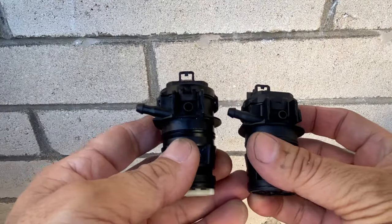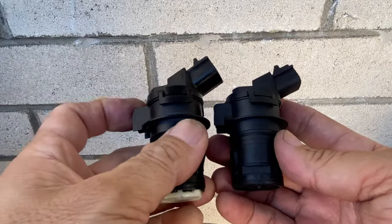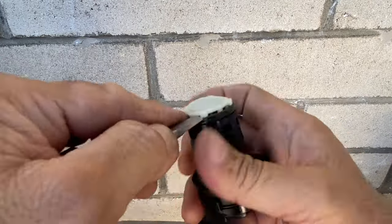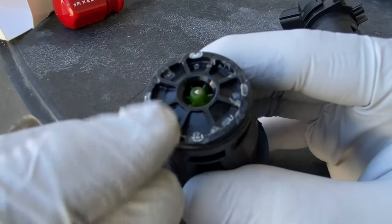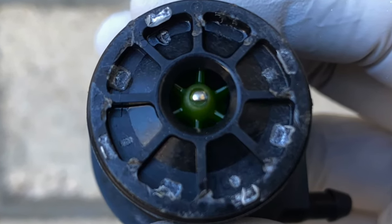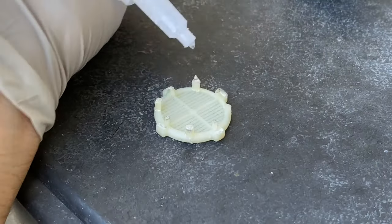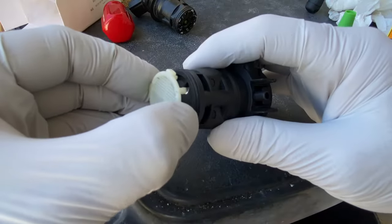On the left is the old pump and on the right the new pump. They look identical except for the inlet screen on the old pump. I carefully pried off the screen and found that it was glued on. I also noticed green slime in the center of the pump inlet — my guess is this is what was clogging inside the pump. Superglue gel was applied to the four thicker legs of the screen, and the screen was placed on the new pump.